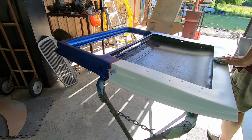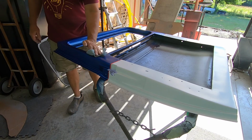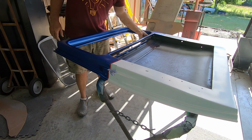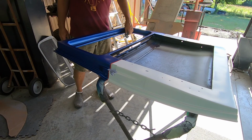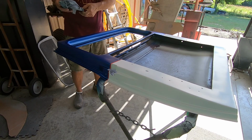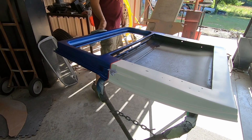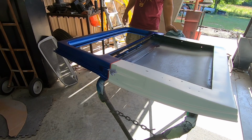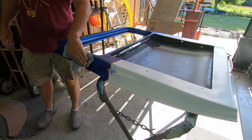The tough thing about doing all this stuff is you're on a time crunch, right? That base coat, it says that it's open to recoat for 24 hours. Well, that's 24 hours at a certain temperature, which in our case would be like 70 degrees. There's a rule called the 15-degree rule, and if you're 15 degrees above that 70 that they figure in the lab, then all your flash times, your dry times, everything is cut in half. And conversely, it's true if you're colder.